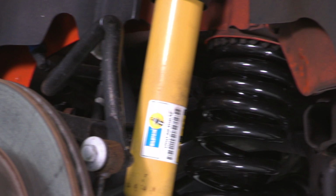Linear, on the other hand, are a little bit more predictable. They're the exact same spring rate regardless of the driving scenario. They'll be the same on the road as they will be on the track, which is typically a better choice, or a preferred choice, for guys out there who have a dedicated track car. They know exactly how it's going to perform every single launch. Progressive springs do change depending on how much load is on them and how hard you're thrashing on them.